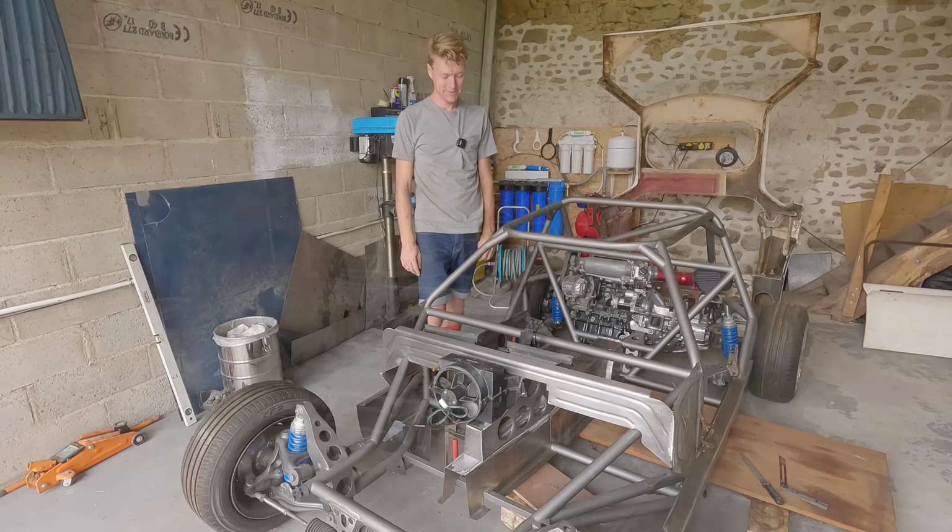Yep. Because we need to do a bit of a weld-a-thon. And once you start welding these, it's a really time-consuming process because we'll have to weld them, cool them down, weld them, cool them down with compressed air. Because when you weld something so thin, it has a tendency to twist even more, which obviously is an issue because it's already quite twisted. So that'll mean clamping it up, welding a bit, moving it, clamping it. That very time-consuming process is something that can happen next week when we do these side panels in here. But for now, shall we make our other side? Yep.